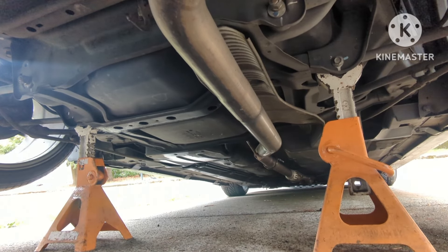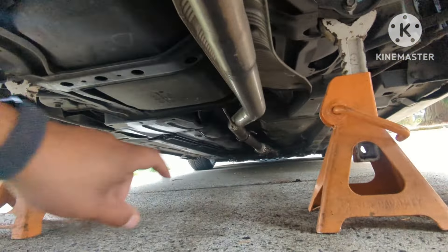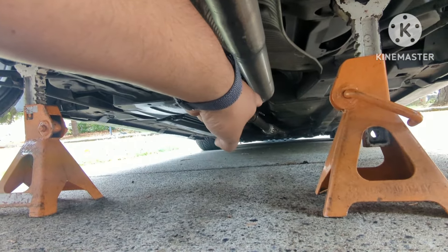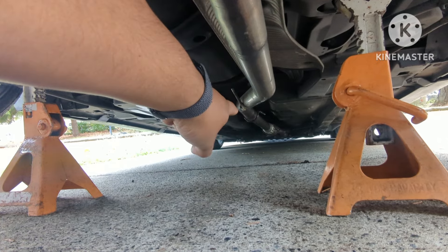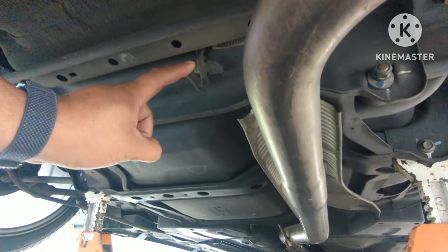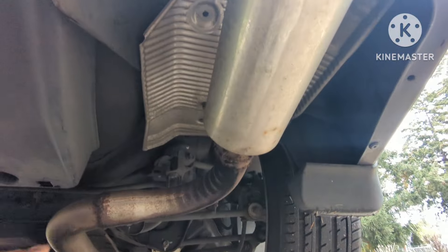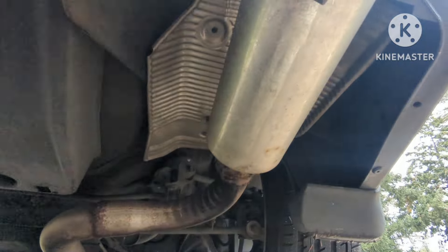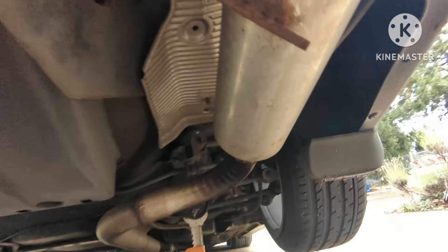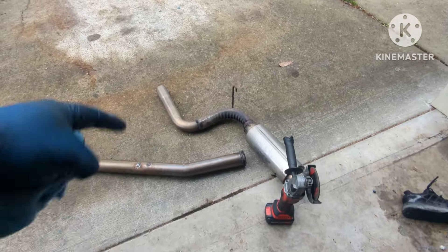Tired — I don't know why. And that thing is low, dragging the plastic. Anyway, I'm going to take it off from the V-band. That needs a hanger there — I believe I'm going to try to do a hanger here so that way I can just have an angle here, so I can just swap mufflers whenever I want, angled out. I don't know, we'll figure something out. Okay, so I dropped the exhaust — the V-band, 13mm, half inch, whatever.